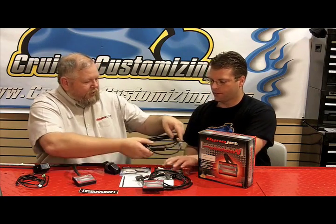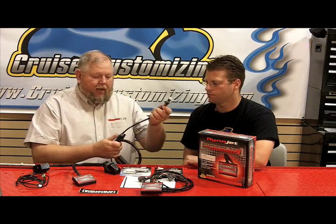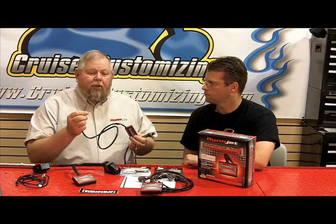This here is the Auto-Tune unit itself. We have the O2 sensor that goes into our pipe and connects up to the Auto-Tune unit. This particular Auto-Tune unit has a single O2 sensor and is for tuning on single cylinder, two, three, and four cylinder bikes — it can be used on almost all bikes. It plugs into the Auto-Tune box, I need to pick up 12 volts to run the heater on the O2 sensor, and then it plugs into the Power Commander. When you get down to the basics: install the O2 sensor, plug in 12 volts, plug it into the Power Commander. It's a very simple installation.